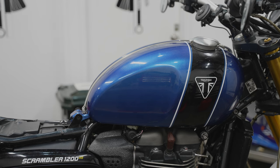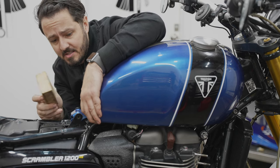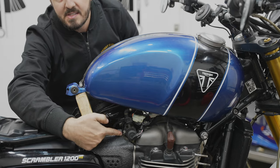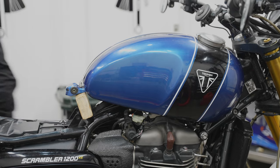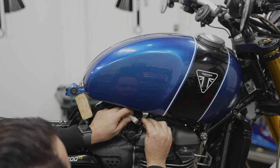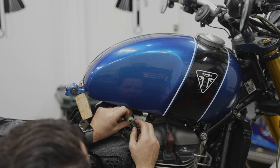Next, I use a little block of wood like this just to lift up my tank. I sit it up so that I can get clearance and access under here to the fuel line and remove that. You'll see there are these connectors here, and they'll be plugged in.